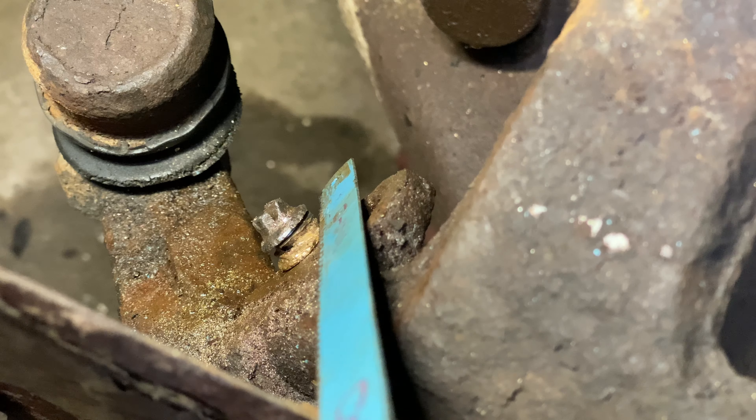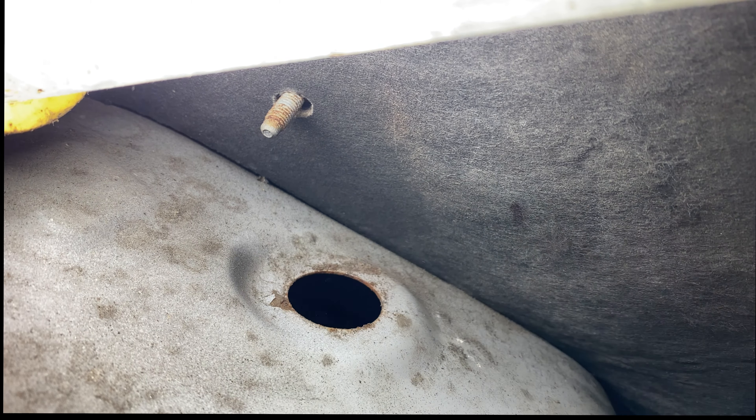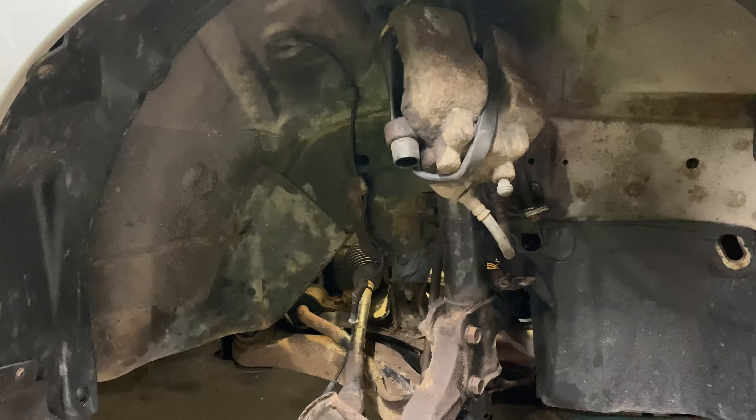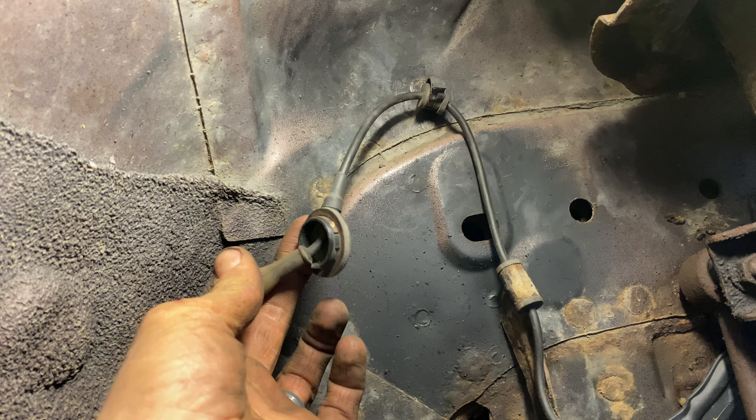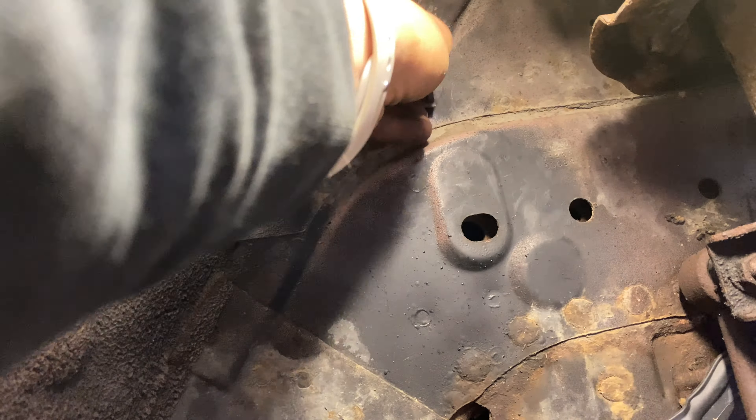The now marred bolt was reused higher up on the retaining bracket. Moving to the engine compartment just above the wheel well, depress the clip which connects the lower ABS line and separate the connection. Push inward on the clip holding the ABS sensor fitting in place and lower it into the wheel well. Back at the wheel well, remove the ABS line from the clip holding it in place and then pull the clip out using pliers.